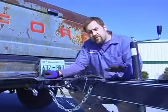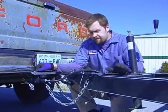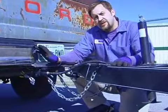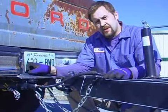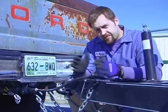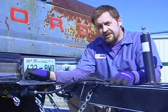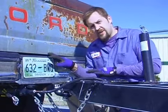If you have a trailer brake on something larger — a trailer like this that's a car trailer or equipment trailer — that's going to be wired through this connection. You're going to have a box in the front of your truck where you can set the control on the electric brake on the trailer, adjusting how much pressure you want that brake applying when you hit the brake. You can adjust it for more or less, which will definitely help you stop a lot better instead of having all the weight on the trailer pushing your vehicle forward.